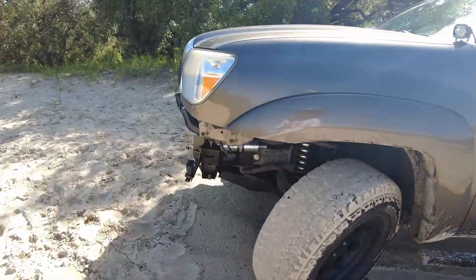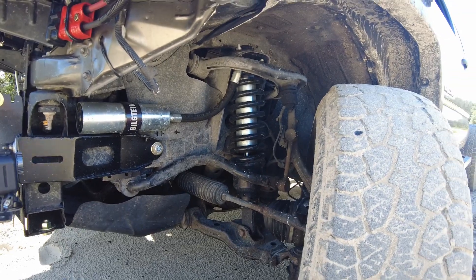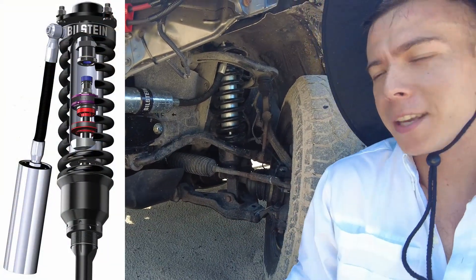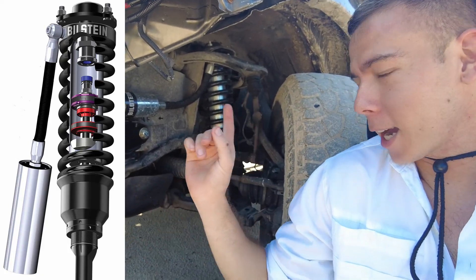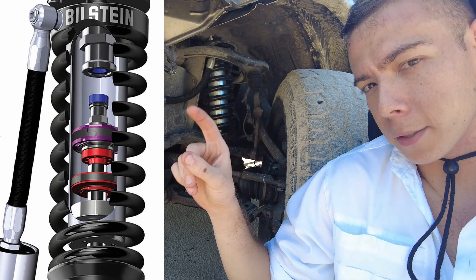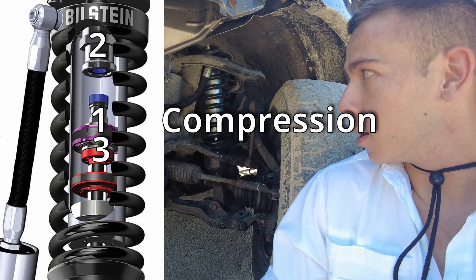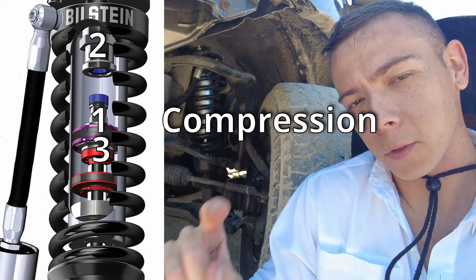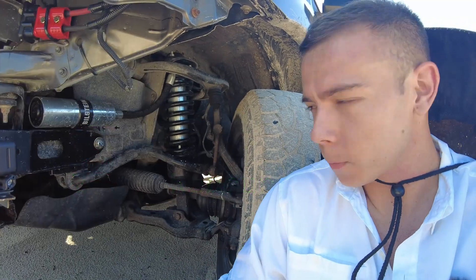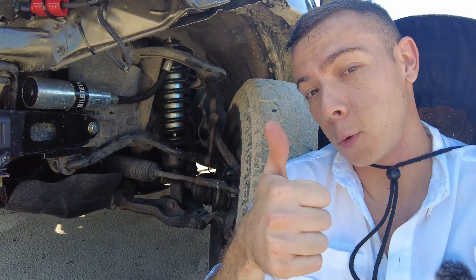Now let me take you back to the front of the truck. I know this looks like a coilover but it's far from a conventional coilover — these shocks are an absolute brain bleed to understand. At some point I'll do a video explaining how they work, but they're kind of like the rear shocks except better. They have three stages of compression — a normal coilover only has one — and also two stages of rebound, again versus one for a normal coilover.